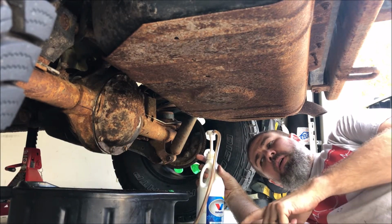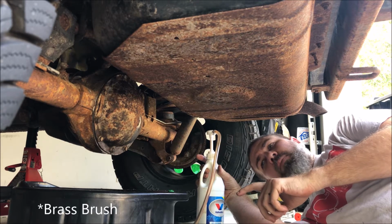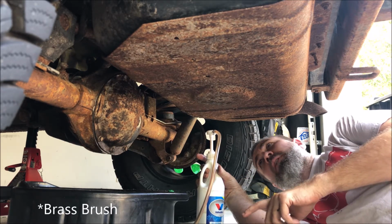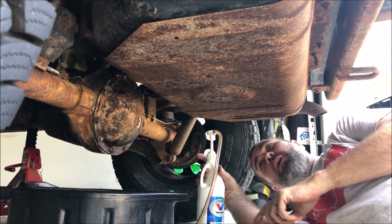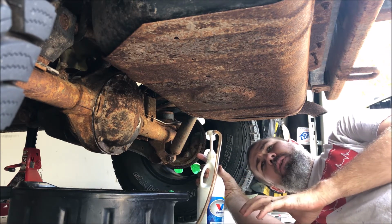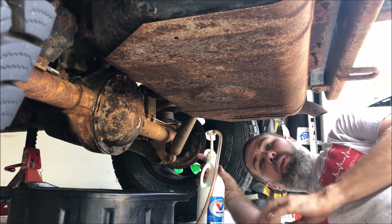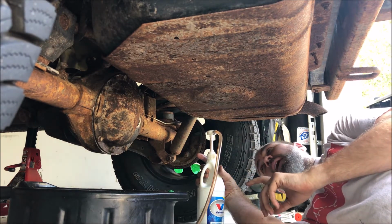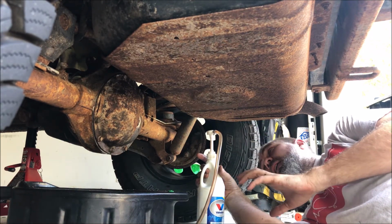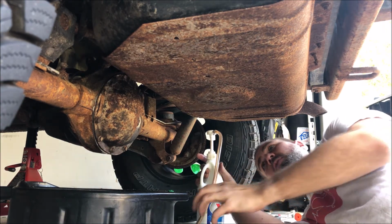All right, so one thing I didn't mention about the bolts is that I also took a bronze bristle brush and brushed them off, cleaned off the bolts. I'll put a link in the description for the lube blocker gasket, because like I said, you don't use RTV on that, and you also in theory can reuse it. I haven't gotten to that point yet. I have a lube blocker gasket on the front differential now too, and it's been a week and there's been no leaks at all. So far so good with that.